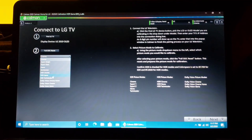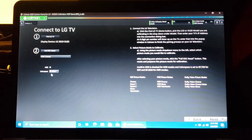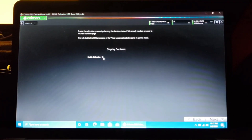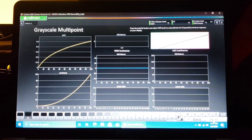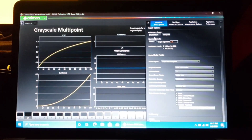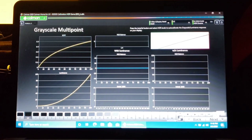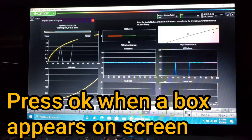Select HDR Cinema. Make sure HDR is checked and BT.2020 is checked, then run a full DDC reset. Once done, go Next, Enable Calibration, and go Next again. This is the grayscale — the bread and butter of the calibration. Before you begin, press the gear icon, make sure you're on BT.2020 Power 2.2, and in Application Measurement make sure you have dEITP for the formula. Close that and go ahead and run Auto Calibration.